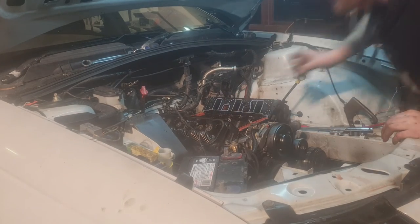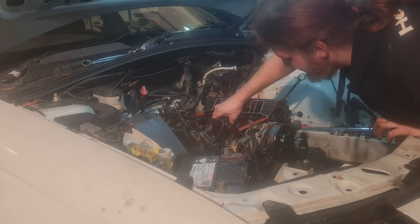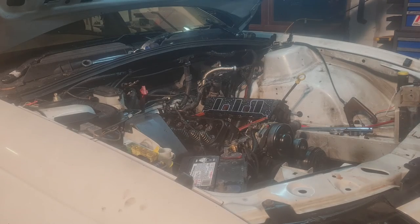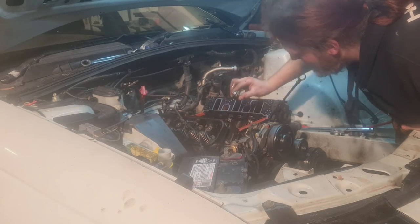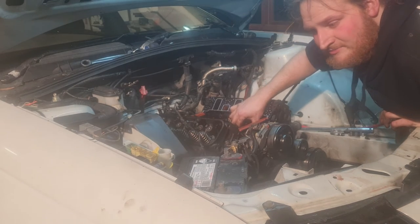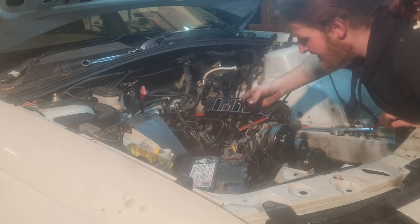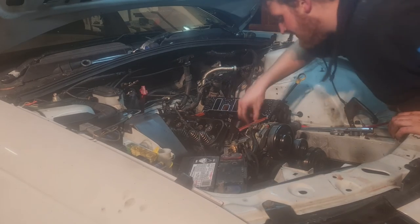What I'll do is I'll get some brake clean, some grease, and I'll clean them up again and verify. I have photos from last time. They were out. And mind you, they did go back on their exact lobe that they came off. I'll clean them up. The photos I have from last time are to make sure that it hasn't actually done any more damage. I'm actually kind of excited to pull the timing case off and actually have a look at the camshaft in it.